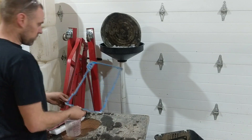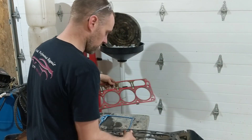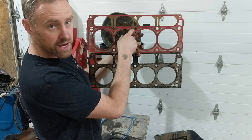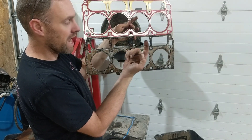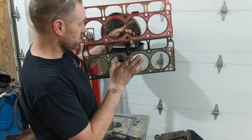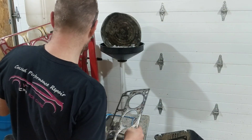We have that embossed sealing approach in head gaskets as well. I have three different types of head gaskets here, and we're going to talk about a fourth one in a little bit. These two gaskets here are very similar — they are the factory head gaskets for different GM trucks. This one is for the LT-based engine, 2014-plus models, and this one is for the old school stuff — it's actually from my personal vehicle, you can tell by the grime.